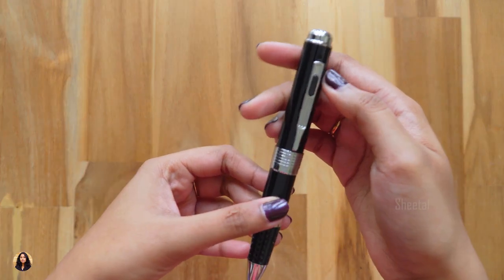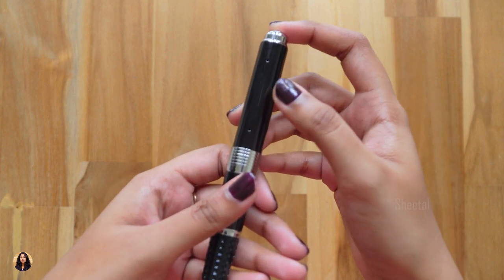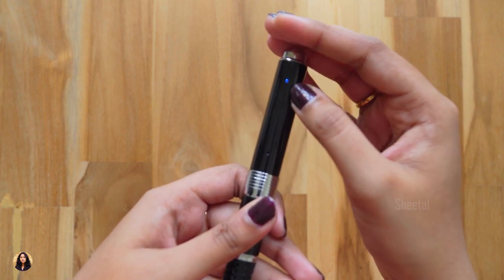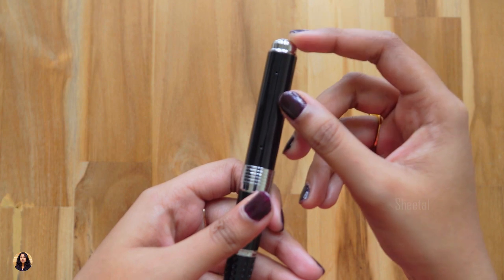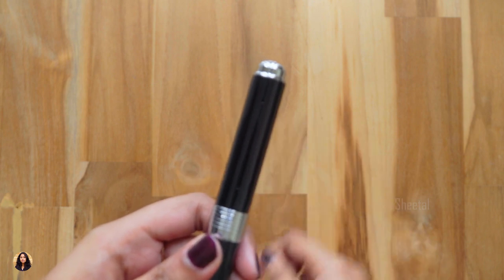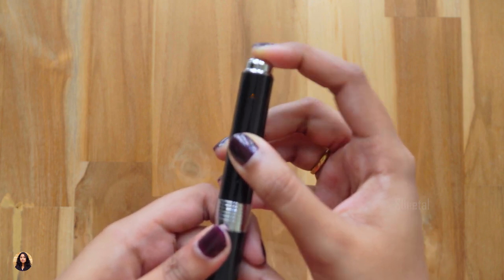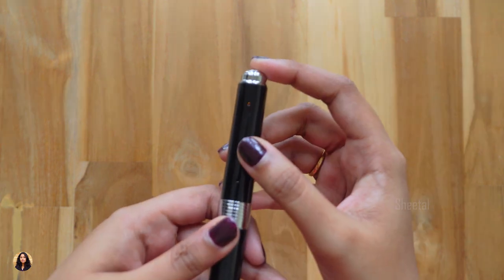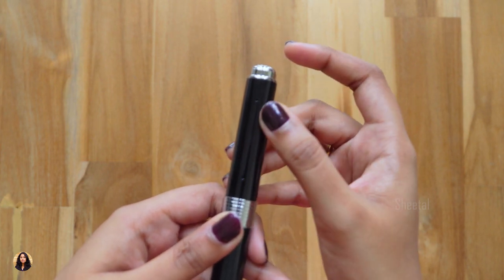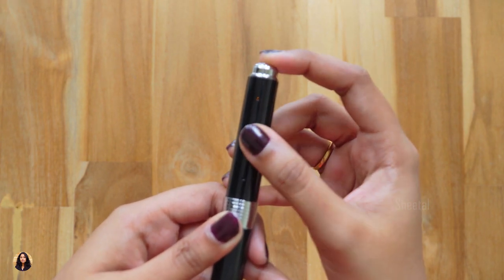I'm back — I've charged it and now I'll show you how to shoot photos or videos with this pen. If you long press this button, the LED indicator turns blue and flashes twice, which means the recording has started. Right now it's in mode 2, which is the video mode, and in this mode while recording the LED indicator is off so that no one will know that you're shooting secretly. If you short press the button, the LED indicator turns yellow, which means the recording has stopped and it is in standby mode. If you press the button again, the blue indicator flashes twice and now it's in continuous recording mode — it saves the video files every 15 minutes and keeps recording until the battery is used up.